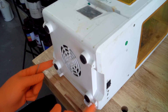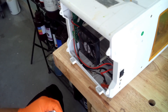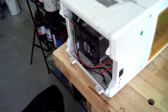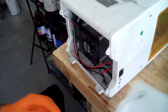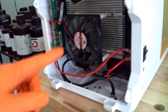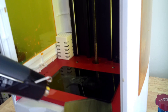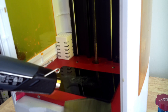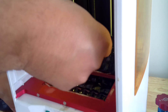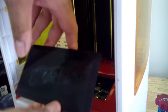I got my new screen and opened up the bottom. There are four screws on the feet of the printer — pull those out and pry off the bottom panel. Where you see the fan, there are a lot of wires in there. You've got your motherboard stashed on the side, your UV lamp, and an exhaust fan. You'll see a ribbon cable underneath the board — just pop that off and pry off the LCD screen. Use a heat gun to disintegrate the glue underneath. Once the glue loosens, use a thin tool like a knife carefully and pry the screen off.